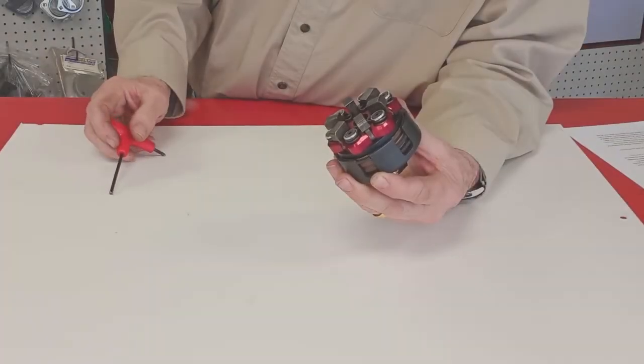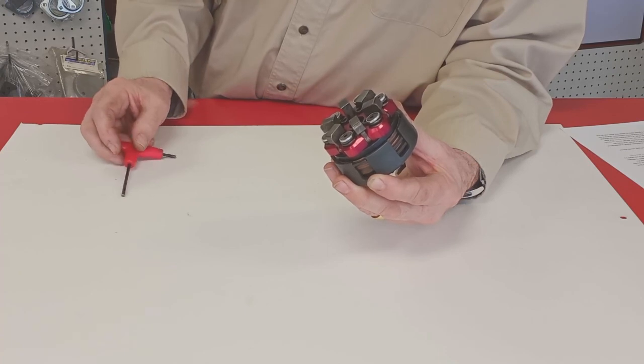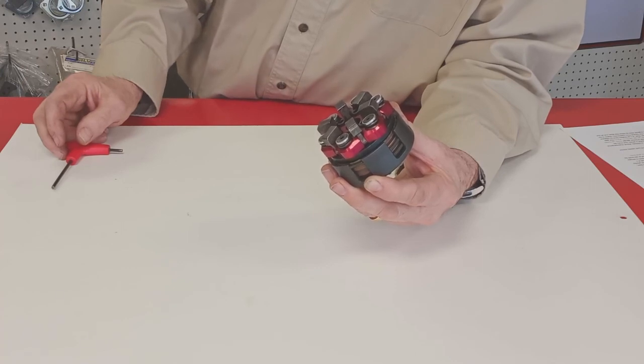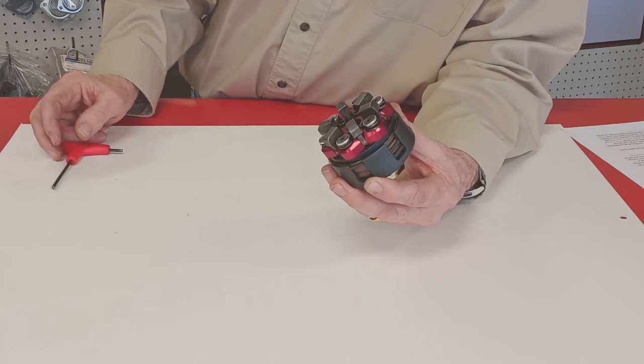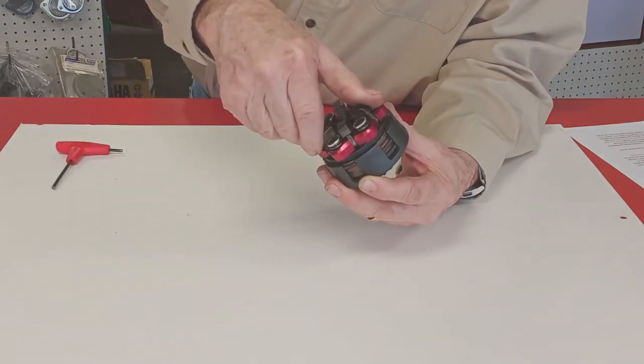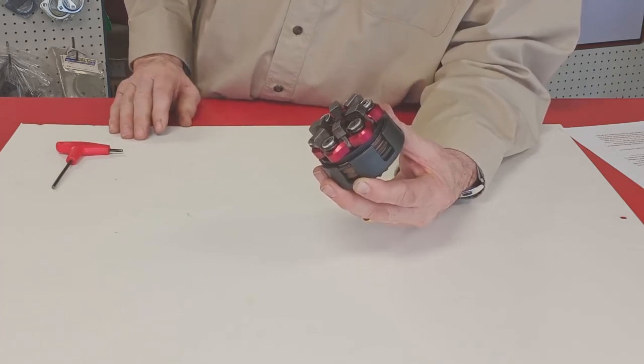This dry clutch mounts directly on the engine crankshaft. It was designed for lower horsepower setups like a Yamaha running a can muffler. Those engines make about 11 or 12 horsepower compared to the 16 or 17 that your Grand Prix engine makes using a tuned pipe exhaust. The advantage of these smaller clutches is they're lighter and they have less angular momentum. That means quicker acceleration, but there's a downside.